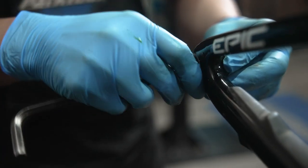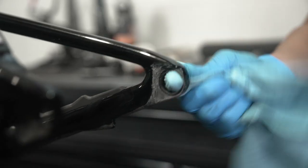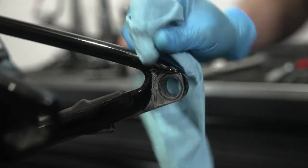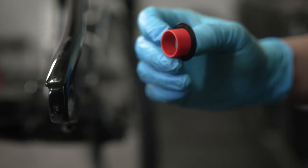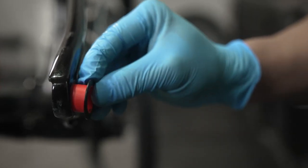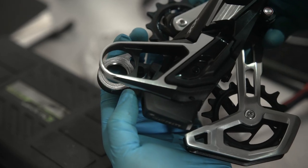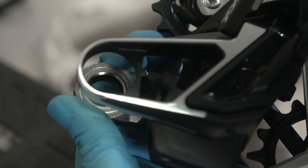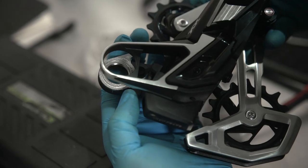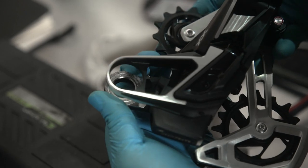Remove the existing UDH from your bike and clean the area prior to installing the new transmission derailleur. Make sure there is no dirt or grease inside your frame. Insert the bushing into the frame's hangerless interface with the lipped edge facing outwards — do not use grease in the hangerless interface. Verify that the knurled ring on the inboard portion of the derailleur's full mount is rotated fully clockwise on its stopper; the stopper must be between the ring's two horns.